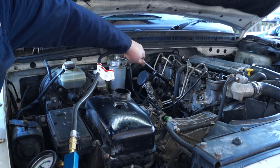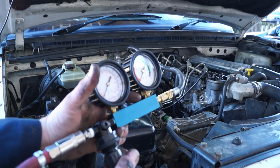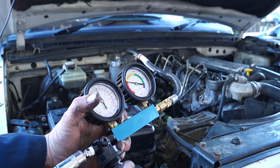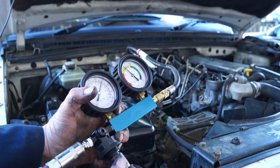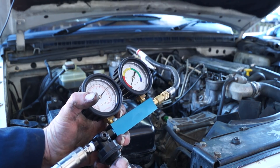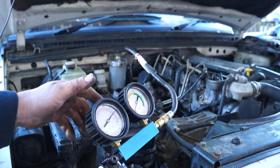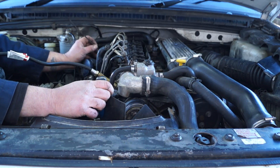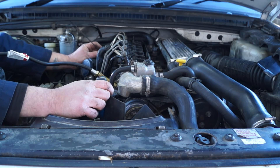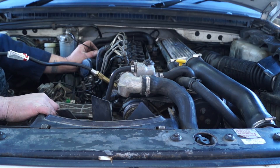I've got number three set. I'll show you what happens when you don't have TDC — because as you put the pressure on, watch the fan spin. See what happens? Bang — the engine's just turned. It's gone to BDC and you can't get a pressure reading. You have to have it at TDC. Just take your time when you do this — you can feel it, you know when it's there. Just remember not to get anything you've stuck down in the bore trapped against the piston and the cylinder wall. It's just a matter of feel, but it's very, very possible.